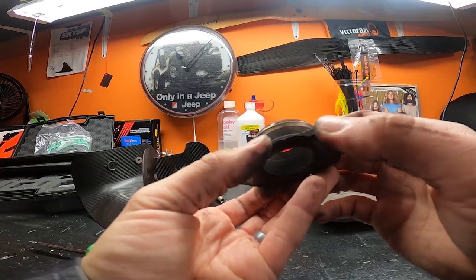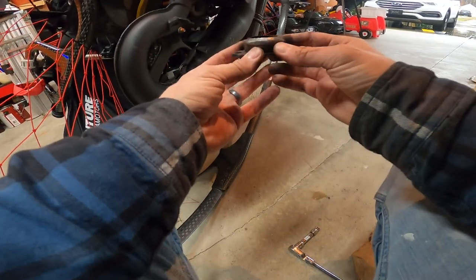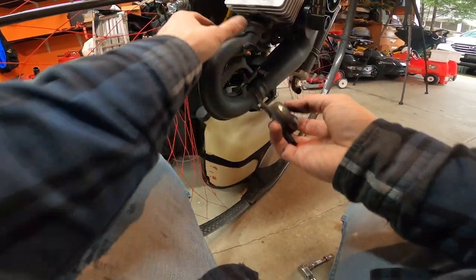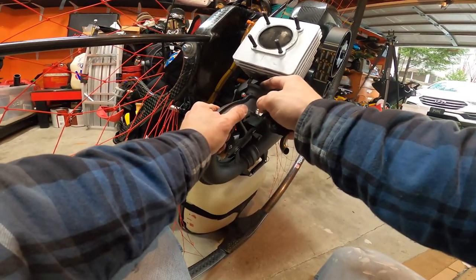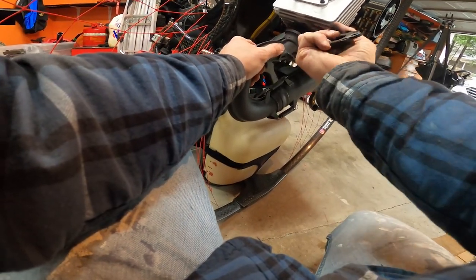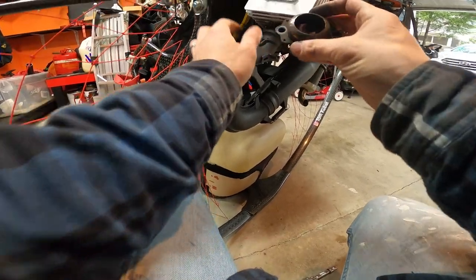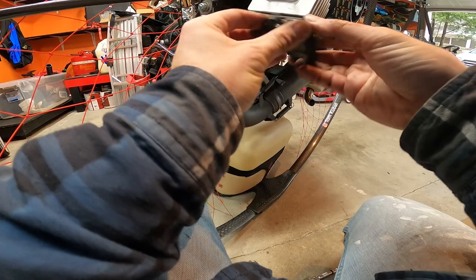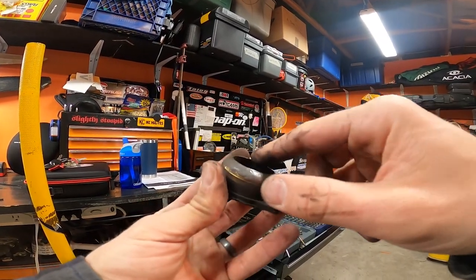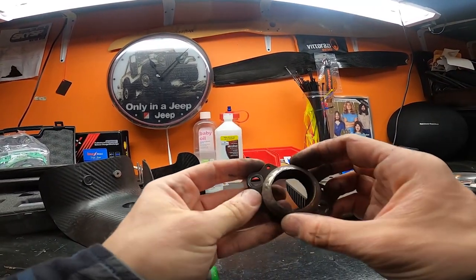So that is amazing. I never got this many hours on the old one. The old one would be long gone and disintegrated by now, for sure. And the flange on the actual exhaust on my old Moster would get messed up because it would hit the exhaust flange on the cylinder and kind of form to that because of the vibration. But this is perfect. That's awesome. I don't even think I needed to change this. I still have another quarter of an inch of bushing left. So that means my flange and my exhaust are both in perfect condition.